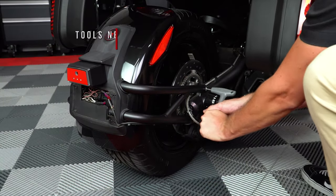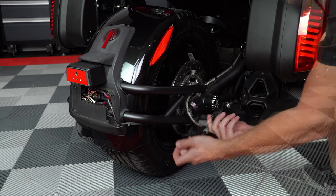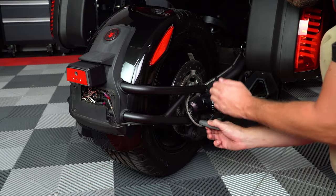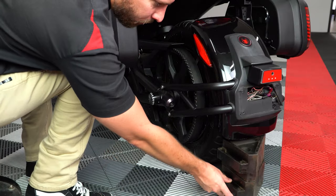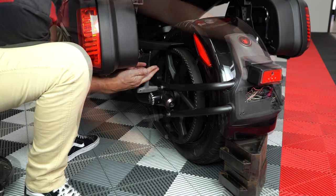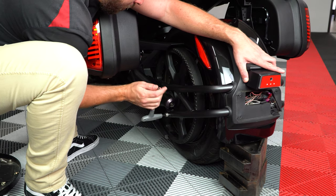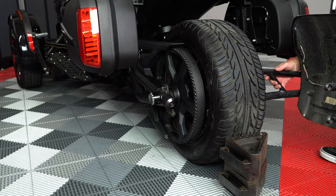Now take an 8mm Allen wrench and unscrew these 4 Allen screws holding the rear fender on. And then before you loosen the last two, make sure you slide something underneath the fender to prevent it from falling and hitting the ground. Then swing the fender out to the right hand side, exposing the back side of the fender,